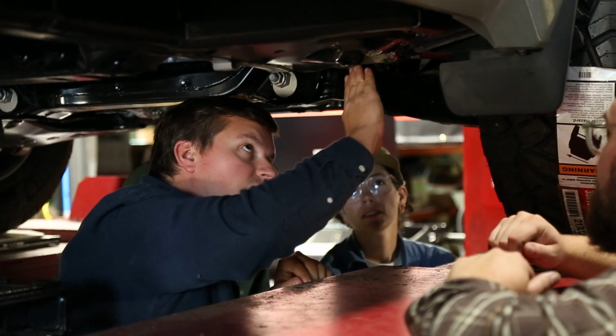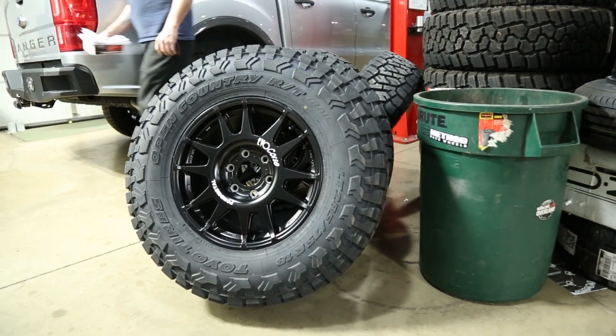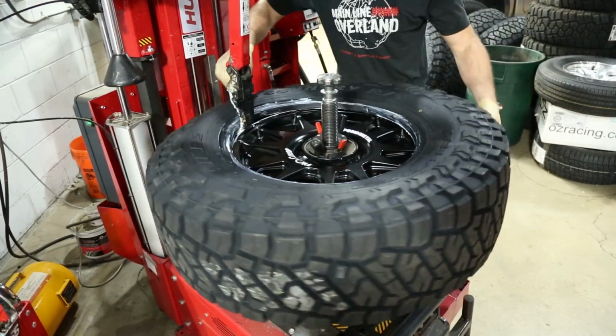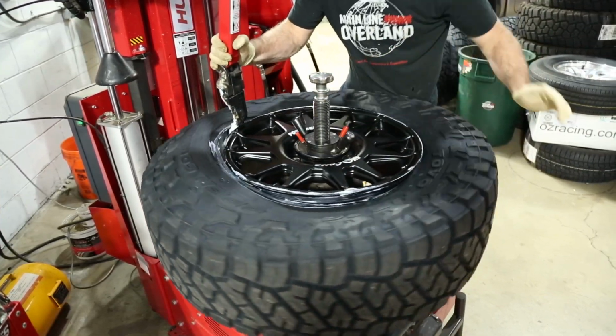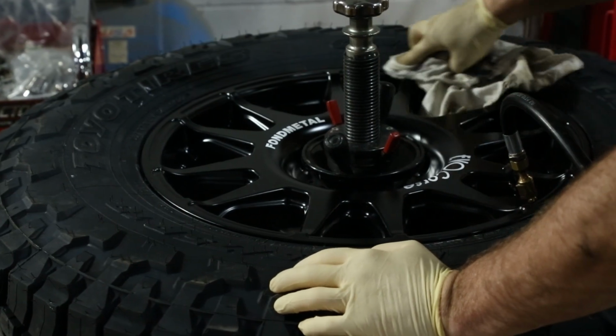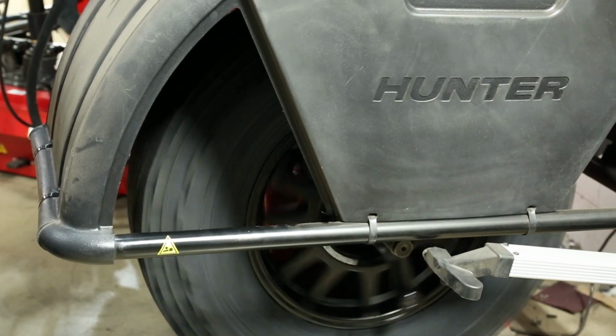A lot of the other wheels that we were interested in or that the customer was interested in just did not meet the needs and the specs that we were looking for, and we had to basically say no to them. And the Evos kind of shine in that department because they are really built for this type of use. So that's the reason that we went with this wheel. It has a very high load rating, higher than an OEM wheel, which not all aftermarket wheels can actually pull off. And if you're looking at an aftermarket wheel that does not have a published load rating, it is because it is lower than the OEM one, and they just don't want to talk about it.